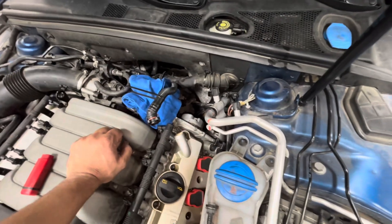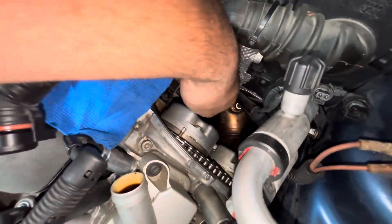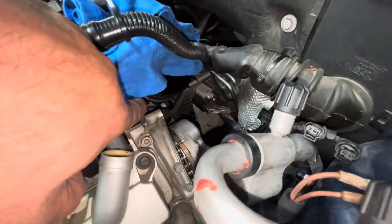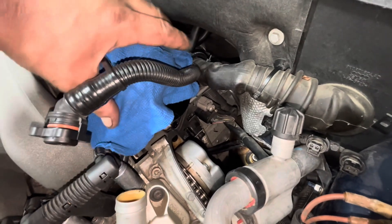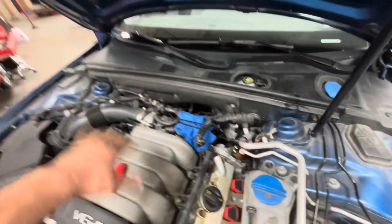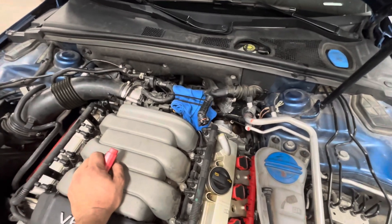Also, if you have a large oil leak in the back of one of these motors and it looks like it's dripping from the bottom side — you can see the lower edge of the timing cover looks wet — also look real good while you're in here at the oil filter housing gasket. Follow this down, look down there at that edge with a mirror. With this cover out of the way you get a little bit better access and you can check to see if that's leaking, because it is an easier job with this out of the way. So if you end up having to replace the oil filter housing, you can replace the oil filter housing, do both these covers, and then the leaks off the rear of the 3.2 should be pretty well resolved. Those are usually the most common of the leaks.